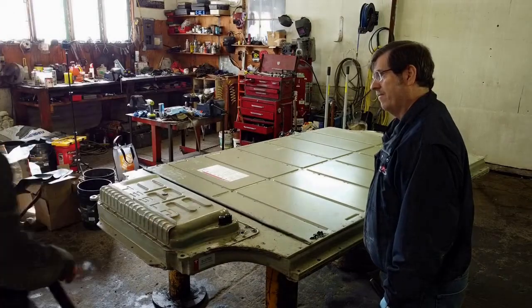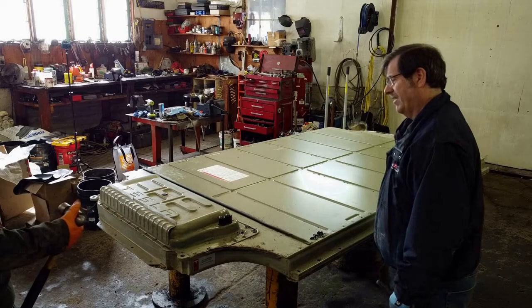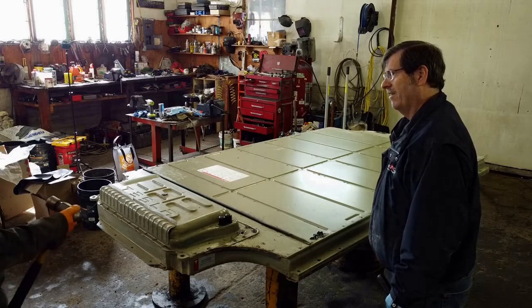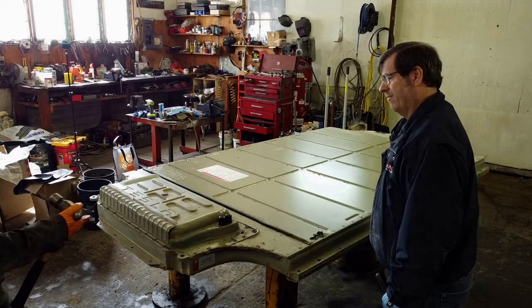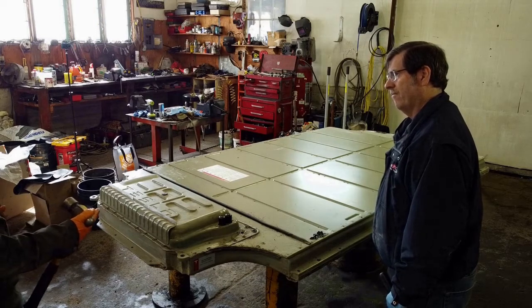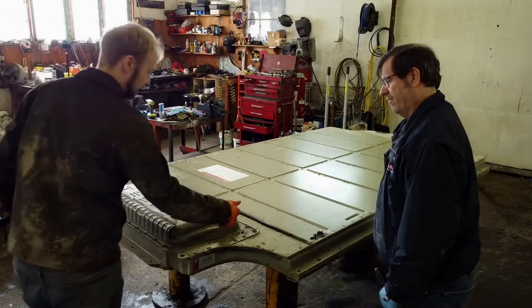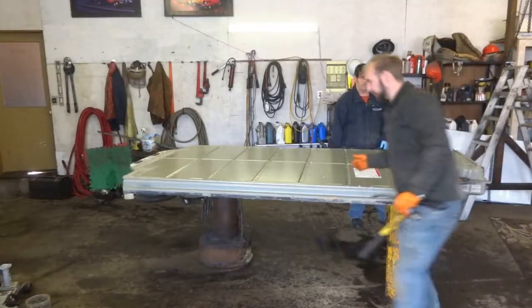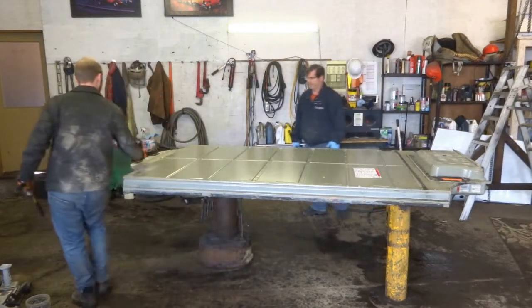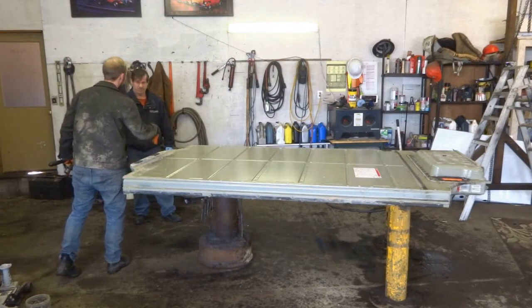So Tesla originally designed these cars to have quick swappable battery packs. Right, yeah. There was only one facility in Fremont where they tried it, and they decided that the cost of the facility made it not viable compared to just making charging faster. But that's why these cars are all quick disconnect. These are quick disconnect coolant inlets. The logic connectors over here are quick disconnect. They just go straight up and down. And the high voltage contactor is just a quick disconnect.